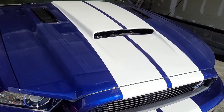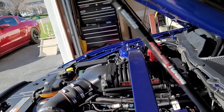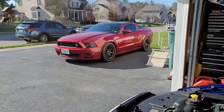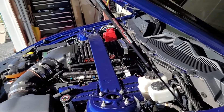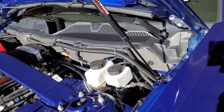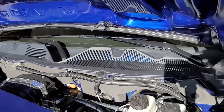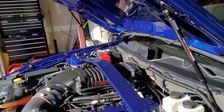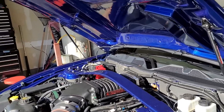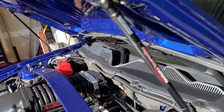With fiberglass hoods, if you're running hood struts you have to use the pop-rivet ones — you can't use the regular ones because there's nothing for them to hook to. The ones I use are the Redline Tuning ones. I have them on this car, that car, Pam's car — every car I own has these. The install is fairly simple on a factory hood, basically a two-minute install. Fiberglass hoods are actually heavier, so you need a little more shock power, and these do the job well.